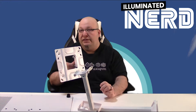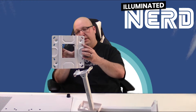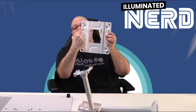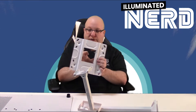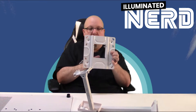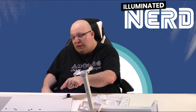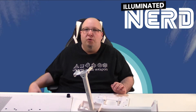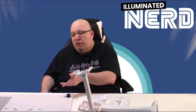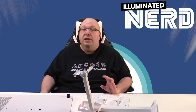The most important part when looking for a mounting stand — whether fully articulating or not — is that the hole pattern matches. This one uses the 200 by 100 pattern. When shopping for a monitor or TV stand, look at what VESA pattern your panel, computer case, or TV supports, whether it's 200 by 100, 75 by 75, or another pattern, and make sure your stand supports that same pattern. Not every stand supports every hole pattern.